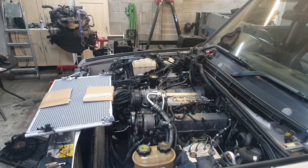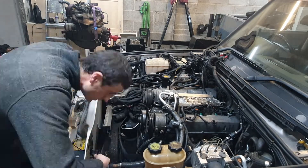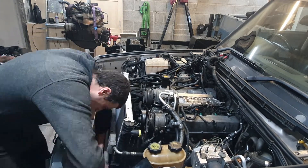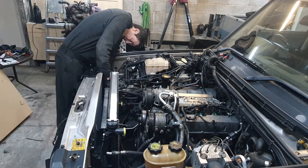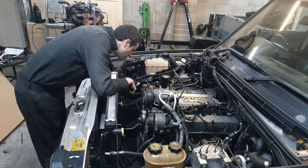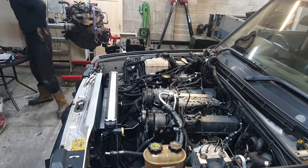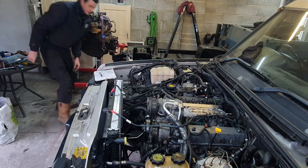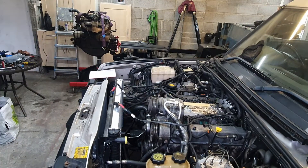First was the front part of the cooling pack — it's an air conditioning condenser, or radiator if you like. The old one was full of holes and obviously the air conditioning was not working, so in preparation for hopefully getting it working one day, I put a new aircon radiator in there. It's not gassed up yet. And there's the two oil coolers — the transmission cooler and the engine oil cooler — and then the new radiator. I want the cooling to be spot on in this engine, because it's one of the contributing factors that leads to liner failure. There's a cooling pipe connection that goes up from the bottom of a Y-piece, like a three-into-one merge collector in the cooling system, up to the LPG reducer and the heater matrix.